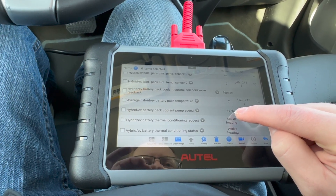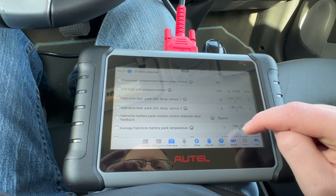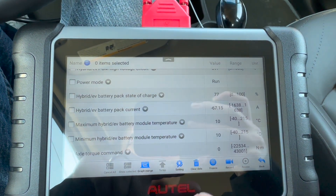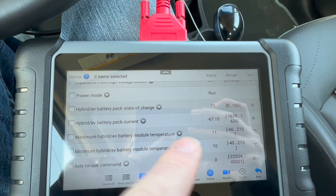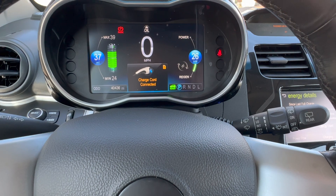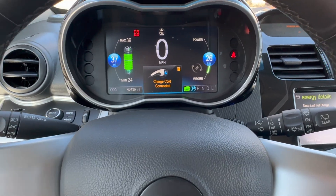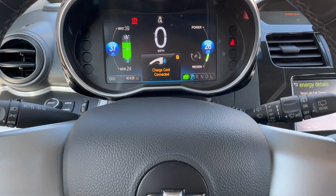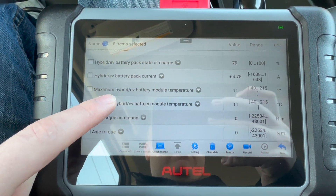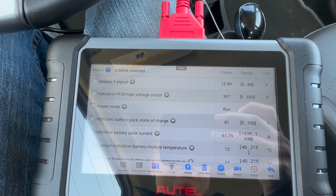Pack has come up to 9°C, with coolant temperature sensors reading 10 and 9. We're up to 77% state of charge and the battery is now up to 10-11 degrees Celsius. Our charging speed has picked up some now that the battery is getting warmer. On this vehicle I've seen it pull 50 to 55 kilowatt clear up to almost 90% state of charge before it tapers down. We'll let it hit 90% and check in on temperature and speed.